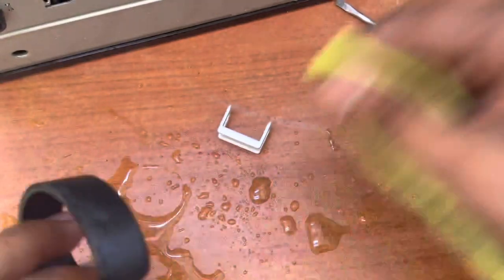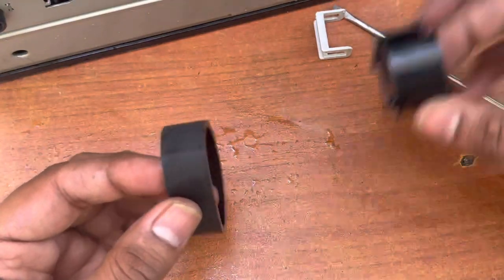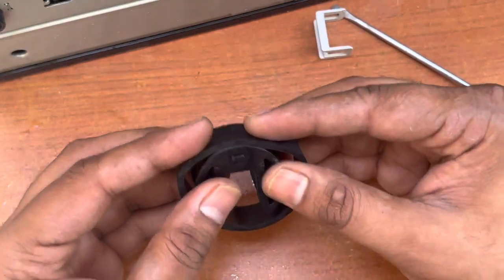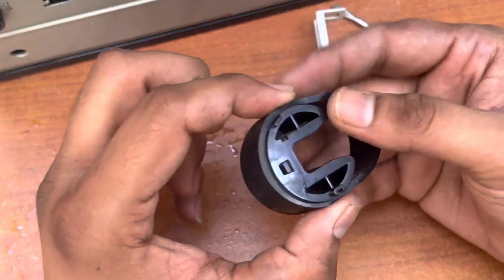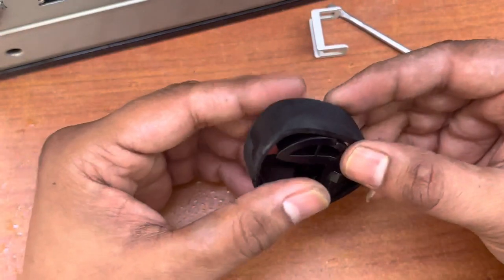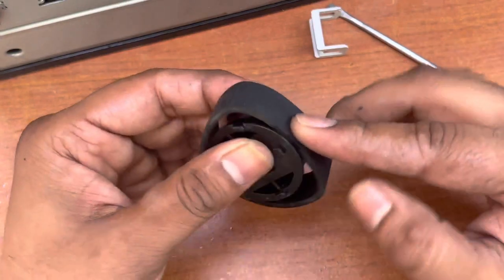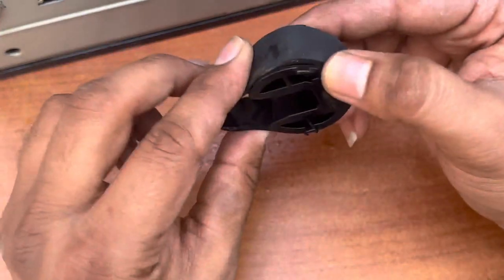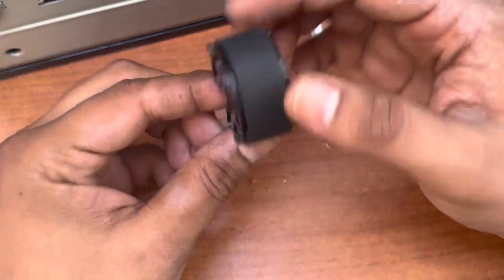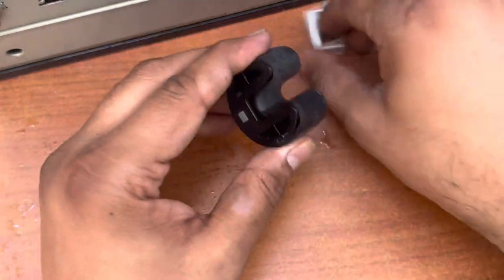After cleaning, we will place some WD-40 spray or any oily spray on the separation roller, but only on this side — no need on the other side. Place it like this in the middle. You can see it will start rotating across the whole surface, which is what will pick up the paper. Place back the lock.